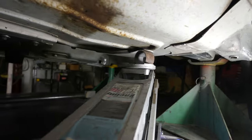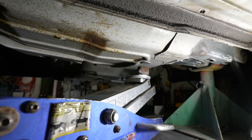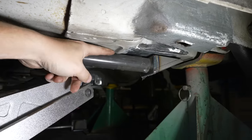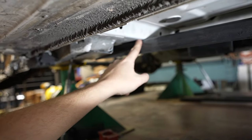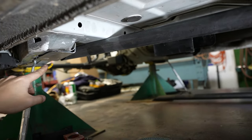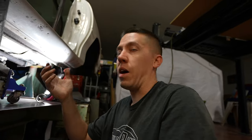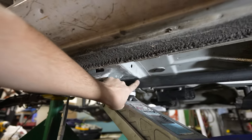I took a little piece of round stock and I'm using a jack to blow the floor up just a little bit — taking it easy, just kind of working that area up until I get enough clearance for the tube to slide right along the floor and tie in back there. We're getting closer; still got a little gap here. Up front we may need to clearance this little cross piece just a touch. On a high-mileage Camaro you're probably dealing with the same thing — floor jack and a jig with everything bolted down is a lifesaver for this deal. I clearanced just a little bit right there and now it tucks up real nice and tight.